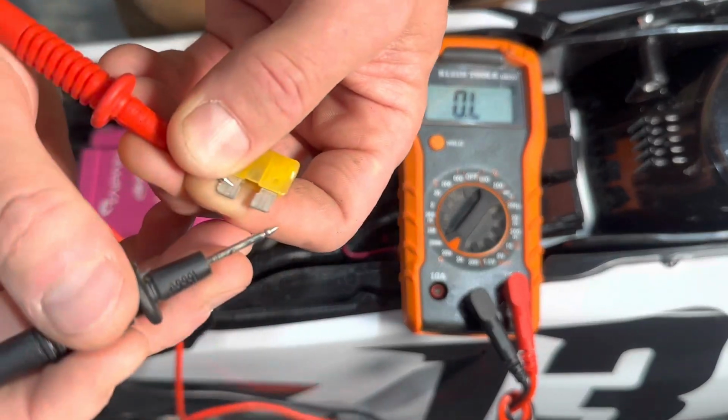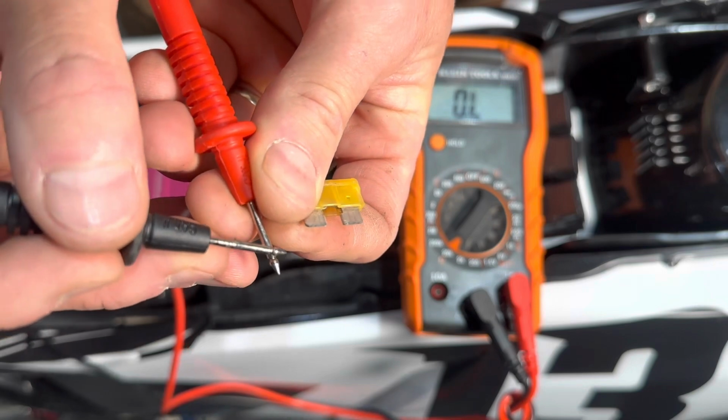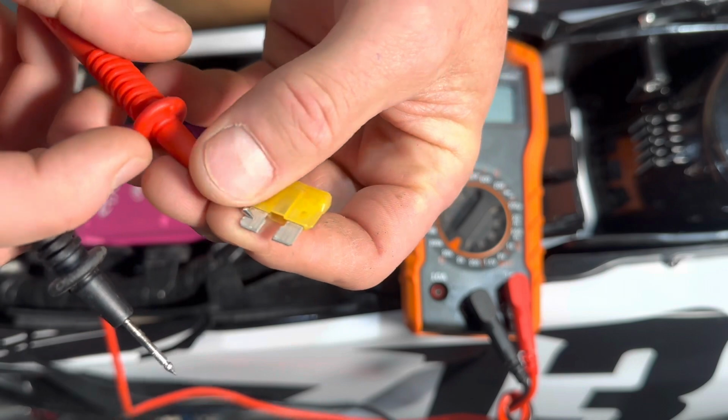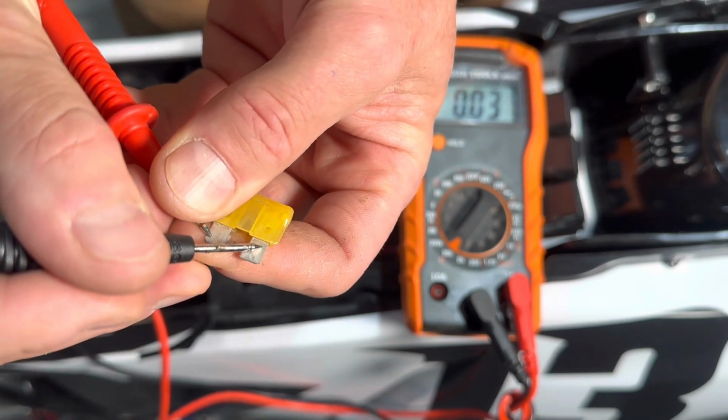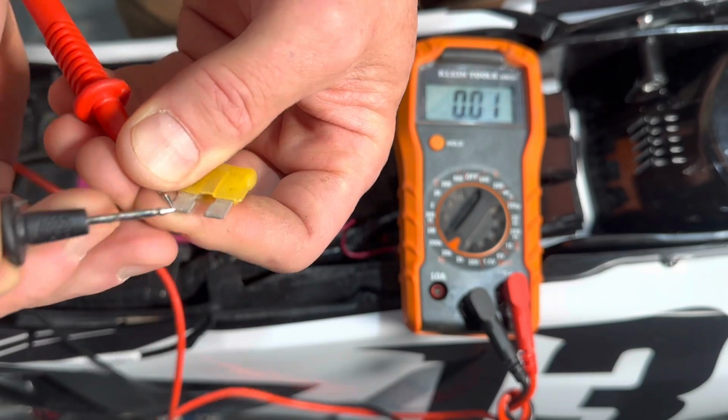Right now we're in open loop, so this is what happens when the meter leads are apart. When I touch them, you'll see that it goes to, shows resistance. So if I go across, I should read zeros. And so that is a pass or fail meter test.